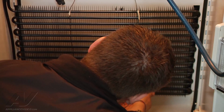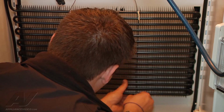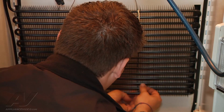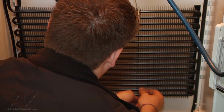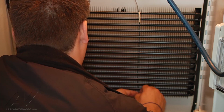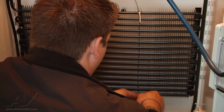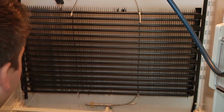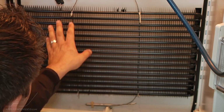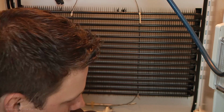All right. So we got it in position. Got my zip tie. Making sure that it definitely goes around the thermostat, or else it won't hold it. Alright, so we got that in place. I'm going to go ahead and tighten it down a little bit, not all the way, because I don't want to tighten these down until I actually have my evaporator mounted. So I'm going to go ahead and get my screws for mounting the evaporator. That way, with this loose, I can feed more down if I need to in order to move my evaporator and I don't damage anything.